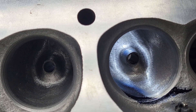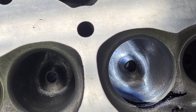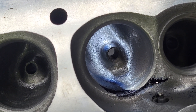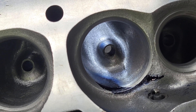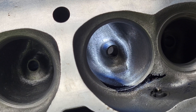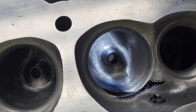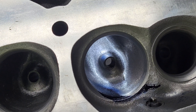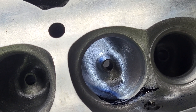I haven't taken my valve bore diameter gauge to them yet, but I know they're not where I'd like them to be. The customer did say he wants to put bronze guides in. I can put thin-wall guides in, hone them to size, and get them just right — but I'd need the new valves to do that, and at that point we'd have to redo the valve job.